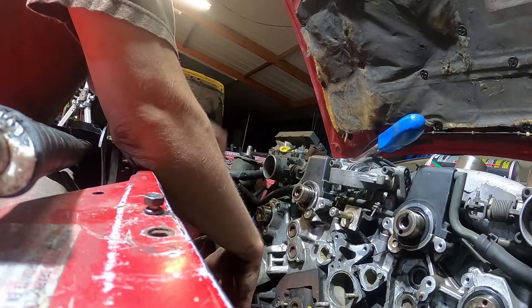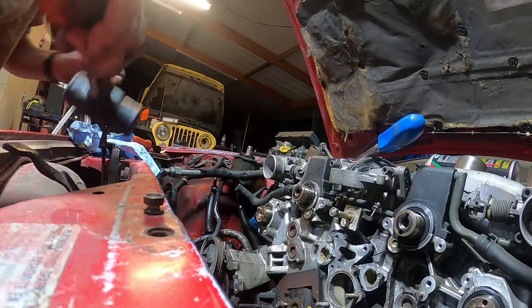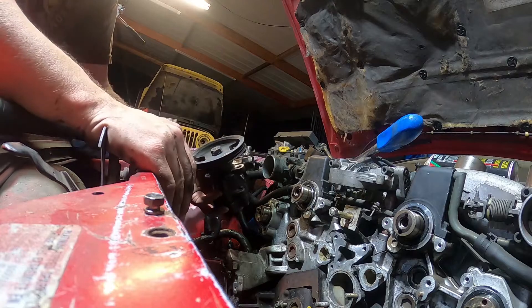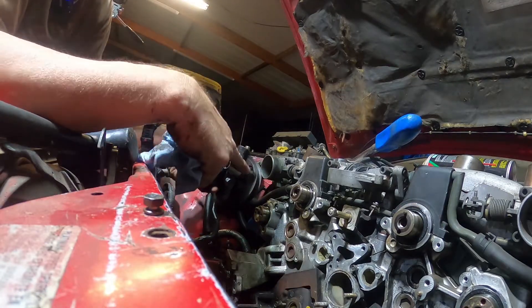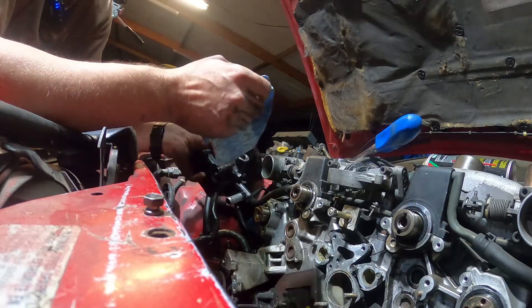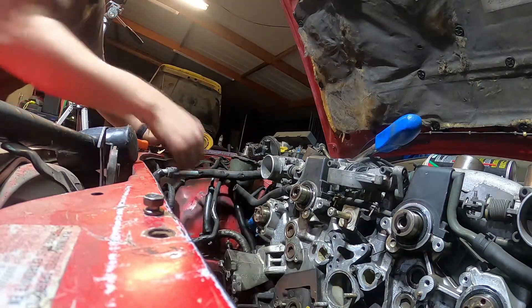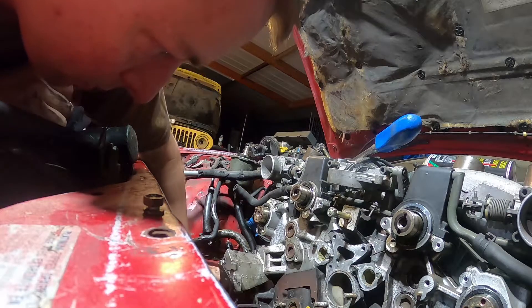We're out. Both our lines are off. Now let's get the pump off the vehicle. It looks like we've got one bolt here, and that's it since we took off these brackets. 14mm, a.k.a. 9/16. There she goes. We don't have the new pump yet, but here's the old one. I'm hoping this is the push-on part. Jared's gonna order the pump from Riley's and I'll go pick it up. Since we got everything out this far, I'm thinking we should go ahead and pull this alternator off.